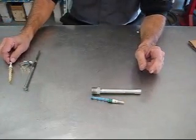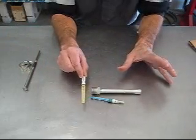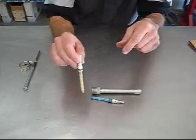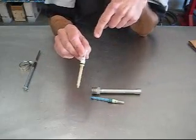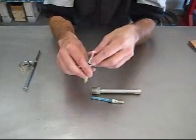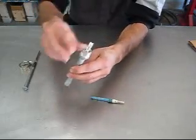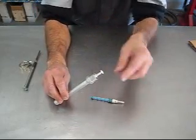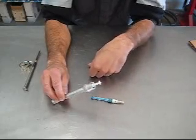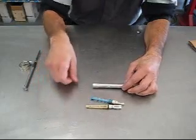Note that in some systems, like some Chevy trucks, just due to where the orifice tube is or the way it's put in, it may be inserted into the tube a little differently, but the flow will always still be from the condenser to the evaporator. When this tube is inserted down into a pipe on the outside of a condenser, you'll see that there are two little wings here for the extractor to grab onto. So once again, long screen always faces the condenser.